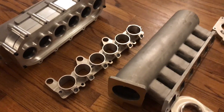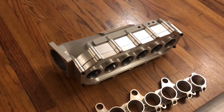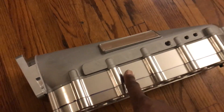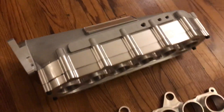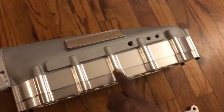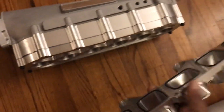If I want to add more intake volume, all I have to do is get extra adapter plates. This is a two-liter spacer and they also have one-liter spacers we can stack in. It's starting to look pretty good. We also have gaskets that go between each section for excellent sealing, as well as the O-rings I mentioned that seal up the ports nicely at higher boost levels.